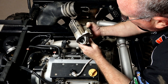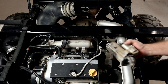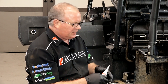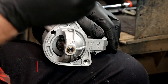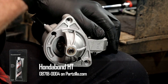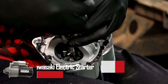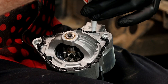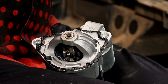Now it's just a matter of getting everything cleaned back up, getting the new one, getting it sealed, and starting to put it back together. All these different mated surfaces, even going on the other side of the starter itself, they all have to be sealed up. I'm using the Three Bond that's recommended by Kawasaki. You can get away with Honda Bond or HT which is for high temp, or Yamabond, or even Permatex gray — biggest difference is mine's black and yours is not. It's important that you get all of these different surfaces sealed back up because we don't want water getting into this area where the flywheel is.